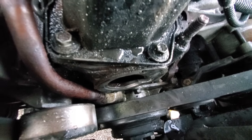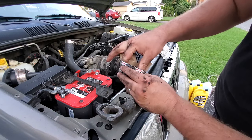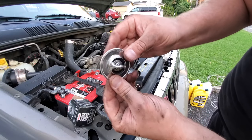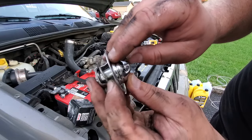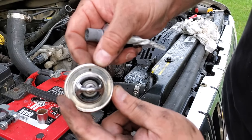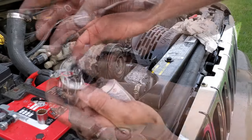The mounting surface is clean and dry. This is a Motorad 5200-195 for the temperature. Going over this — there's no little safety valve, so I'm going to drill a small 1/8-inch hole — actually a 7/64th — just to let some pressure or water through in case this ever fails. It was easy — I just rested it on a block of wood and popped it right through. The thermostat is thick enough that it didn't warp, so that worked out really well.